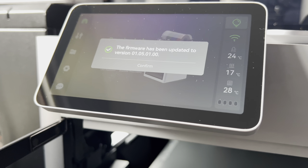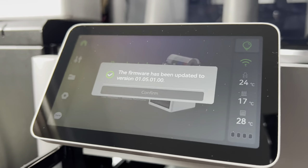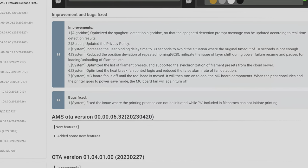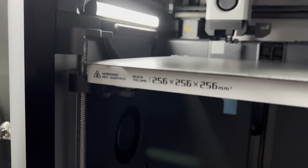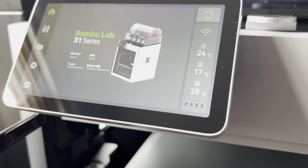After looking up the firmware version on Bambu Labs' website, the improvement turns off the fan when the tool head is not being moved. So this means that when the printer is not printing, you won't hear the fan. So this is what happened in this particular instance. Nonetheless, the fan was still broken — it was just turned off. So I went ahead with the process of installing a new replacement fan.